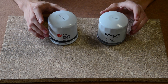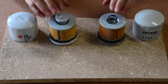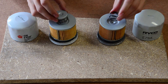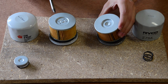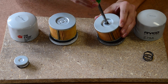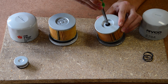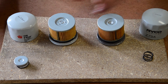We've just cut open both filters and we're going to compare them side by side. The first thing we come across is the retaining springs, which are used in conjunction with the anti-drain back valves to stop the flow of oil when the engine stops — we'll talk about them more later. Next up we've got the relief valves on top. On a cold start, oil is sometimes too thick to filter through the filter element, so this valve opens up and allows unfiltered oil to go back to the engine. Both filters have one.